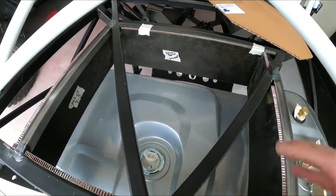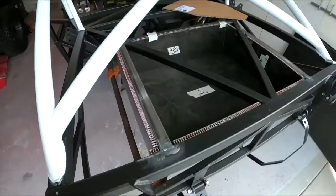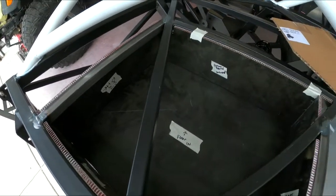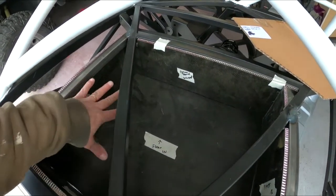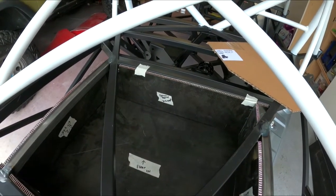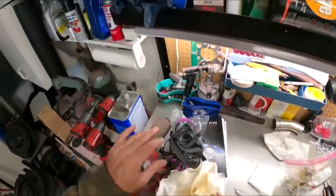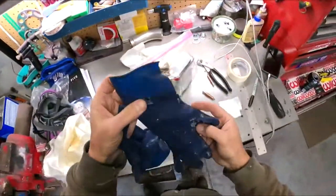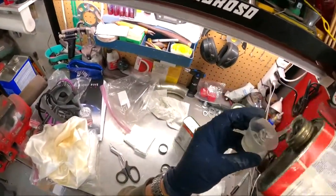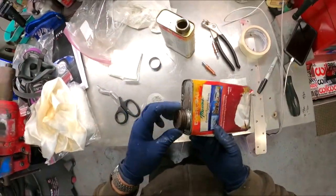You'll have this area here open, and then you'll be able to put stuff back over into here. Not a huge area but should be pretty nice. Carbon fiber box is all mocked up, so now I've got to glue it. I'll glue this, then we can drop the whole thing down and start glassing it up. What I've done is cut the glass up into small little pieces — I might need more, but I've got a whole bunch here. I'm going to throw some gloves on. I hate this epoxy resin stuff. It's just so messy — it's just a pain.